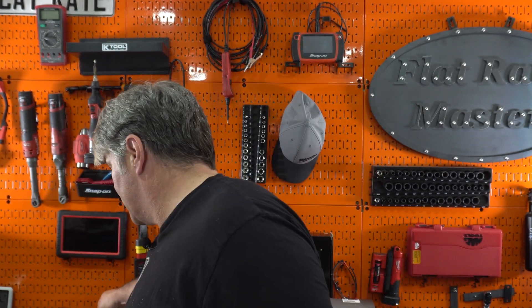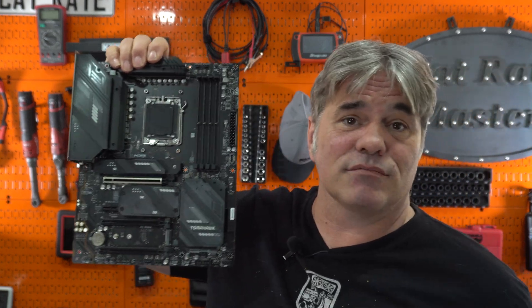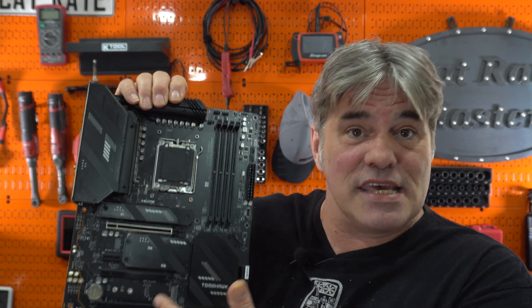This is a placeholder — this is a 7600. The nice thing about the EPYC 4004 series is they slot into any AM5 motherboard. So for instance, you could slot it — with a BIOS update, just like any new processor — into this X670E motherboard.